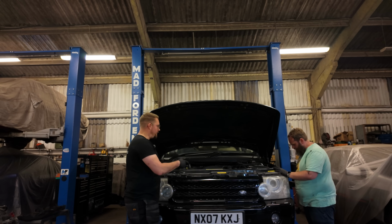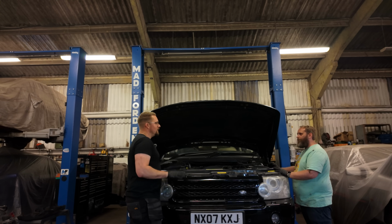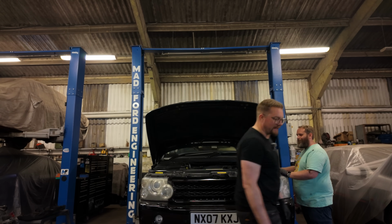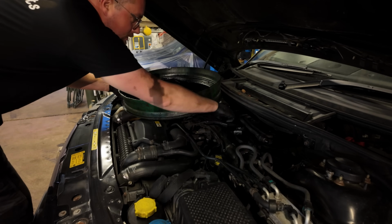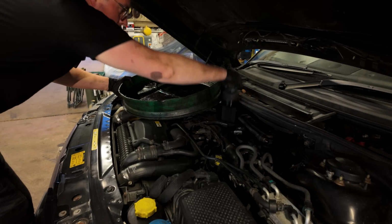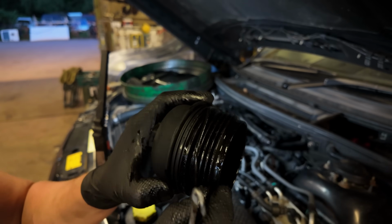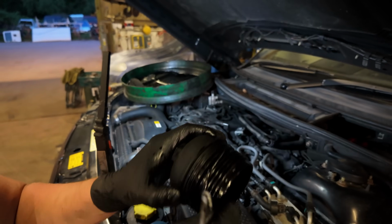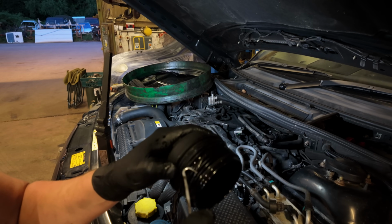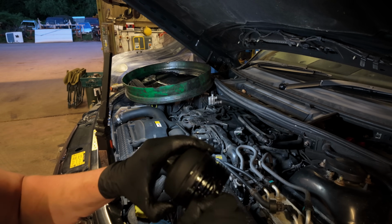Next up then, oil filter out. I'll get a tray ready for that, put it in it, you know, so we won't have a big mess again. Oil filter. Bring our tray close. And then in he goes. I'm just taking the rubber O-ring off this now. It sits in that slot there running round. So just got a pick. We'll have that away, and then we'll get the new one in there as well.